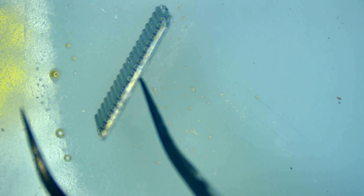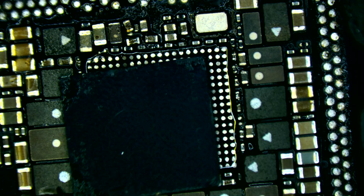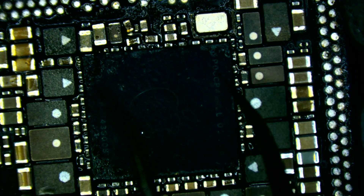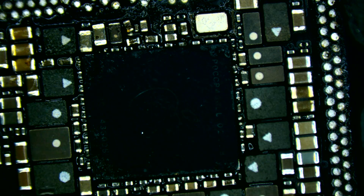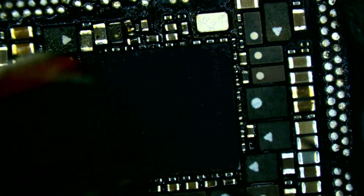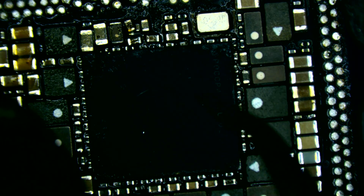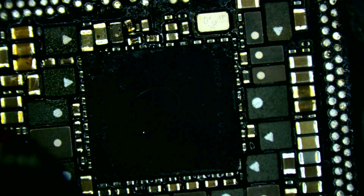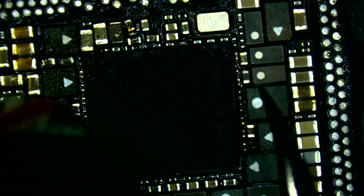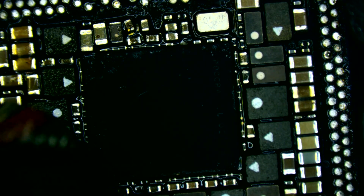To install the IC, make sure there's enough flux covering the solder pads on the motherboard so you don't oxidize any of them while heating it up. You also want to make sure the IC has some flux on it as well to keep the solder balls from oxidizing. You don't want too much flux, otherwise you'll cause a floating action where the IC won't actually be able to touch the surface — that's something that just comes with experience. Now would also be the time to correct any components that are still not lined up perfectly, as sometimes when you heat up and place the actual IC, they correct themselves.